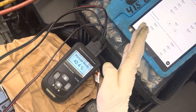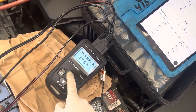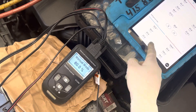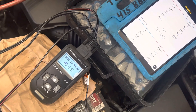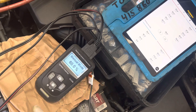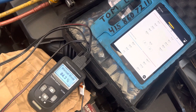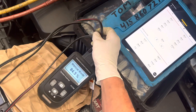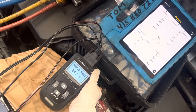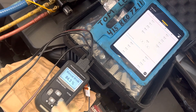Now I'm going to feed it a little more — I'm going to make the displacement go more so it swashes more so those pistons can stroke more. Let's go up to 60. There we go, we're at 60. See that low side going down and high side going up. You'll see the temperature inside the cabin come down. Now we'll go up to 80 percent — this will not allow me to go to 100 percent. Now we see our high side is going to the maximum for the stroke this unit will allow. They have some sort of safety — they don't want you going to 100 percent. So you see how easy that is — you can literally command the pressures up and down.